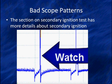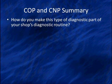And the reason we mention fuel lean out here is one of the things we believe, or I should say I believe, I have made an observation that frequently when I have high failure rates on COP units, I have a lean fuel mixture because of dirty injectors.